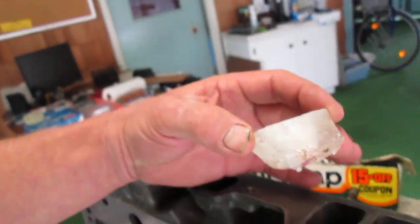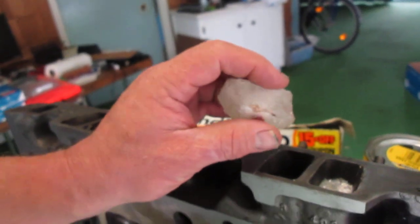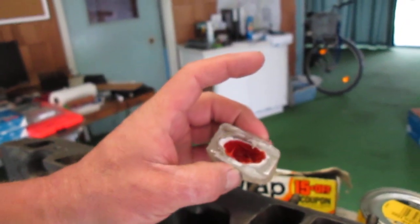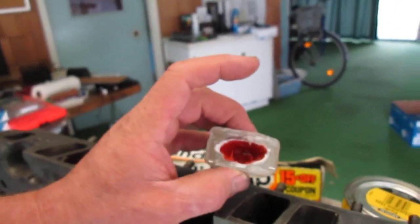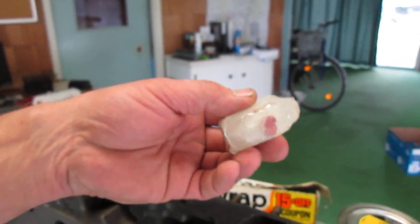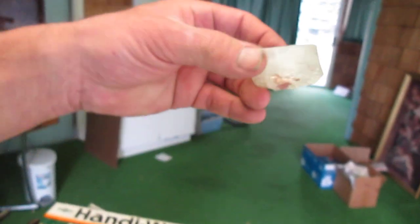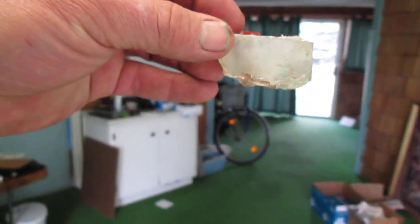these heads are wonderful. These are the best of the lightweight heads, according to everything I read on the market. But like you see, this is my casting plug. Now to get this product, I'm going to sand this off the bottom, make it nice and flat, and then I'm going to put a funnel in here that was set to receive the groove. So I'm going to drill that out. After I sand it down, I'm going to drill all that out of there, and then I'm going to cut the groove into it. And as you can see, perhaps, that's been all the way around here.